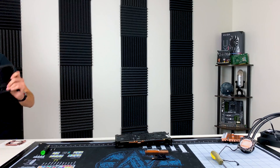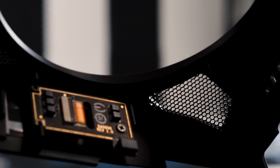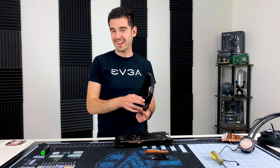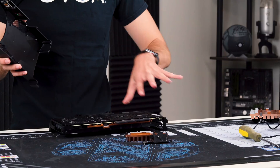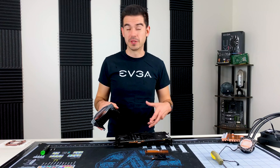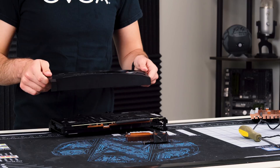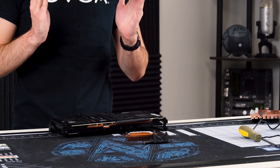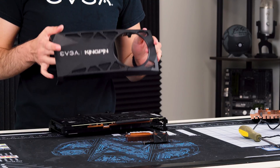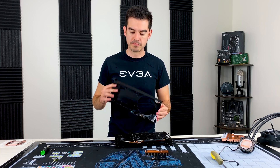Let me show you what I mean here — if I bring this up to the camera, you can see this is the board on the shroud of the Kingpin card, and right there is the header that connects to the PCB with straight pins. I believe the reason we do that is because if you try to do this on the block, especially with the way the block can move around before it's screwed down, there's a very strong chance you would bend and break those straight pins. Whereas with the AIO hybrid shroud, when you pull it up it goes straight up and can't move any other direction, so the pins disconnect cleanly. It's a nice design — it means you don't have to disconnect a header for the OLED; it just does it by function of removing the shroud.